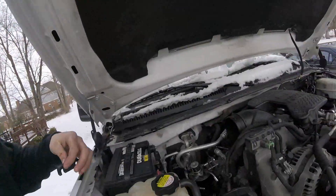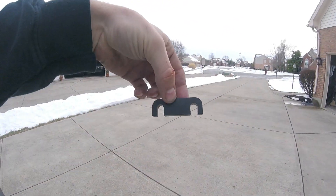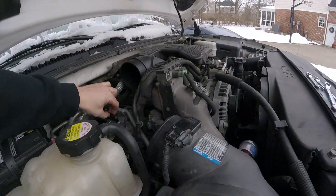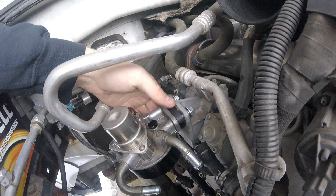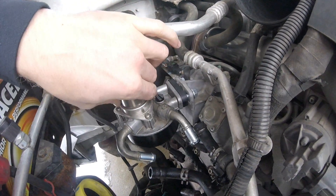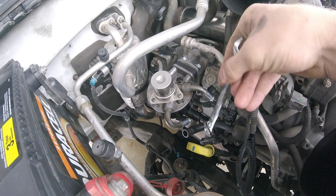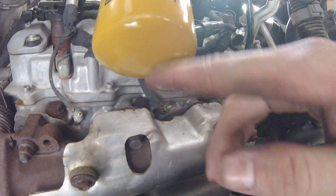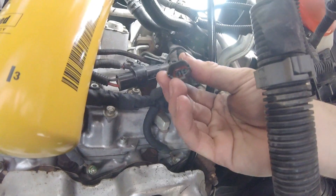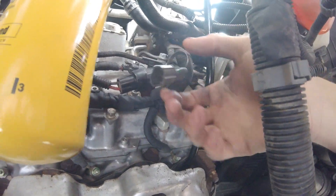We got it back in the truck. There's a bracket piece here that goes in between the filter housing and what it bolts to — it's just gonna slide in before you fully tighten it down, and that's gonna give you a little more room to get the new filter in and out when you have to replace it. Tighten the bolts down and put the fuel lines back on. When you put the fuel filter back in, you're not gonna use the water separator sensor that goes on the bottom of the factory filter, so there's gonna be no wire that plugs in, and that's perfectly okay — it won't throw an engine light.